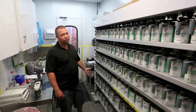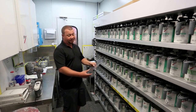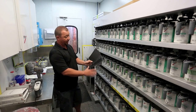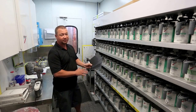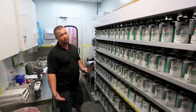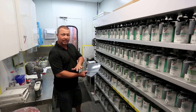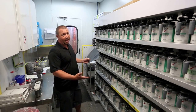That's actually not true. For example, I have some spray out cards here. This is from a Ford — it's a new color, the code is UJ. This is all the same color — all UJ. We have four different spray outs here. This color actually has 14 different variants depending on where the car was made, if it's waterborne from the factory or solvent based — there are a lot of different factors. So now I have to pick one of these, and one of these is going to be closest to the car, and then I might have to tint it to match.